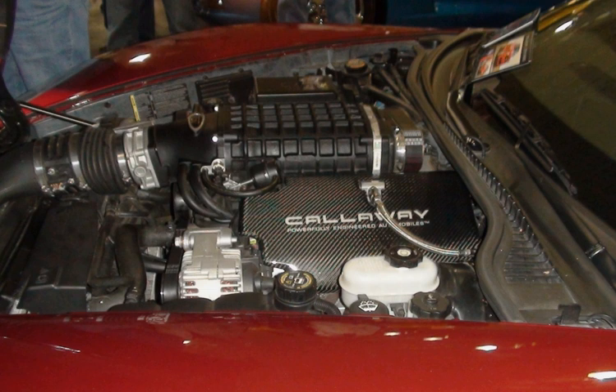The 4.125-in bore block family (2006–present) was inspired by the LS1 in size and performance goals, and was designed for race-oriented performance. The only engine with this bore size used in a production vehicle is the LS7, with the LSX being only for aftermarket use. One unique feature of this family is that the cylinders are Siamesed — no water passages between neighboring cylinders — done to increase both bore size and block strength.